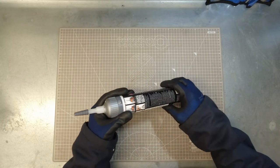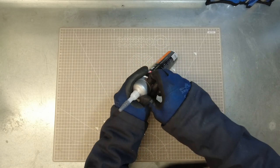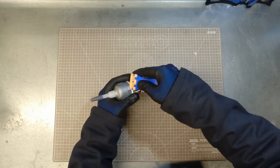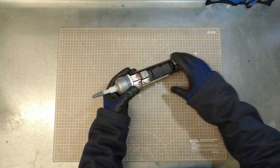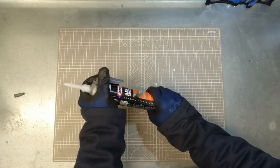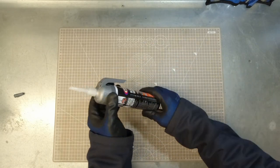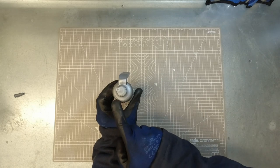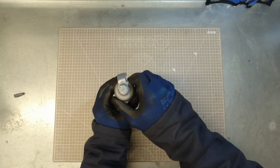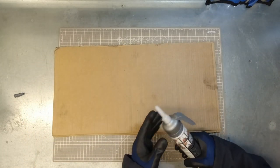So with this, you just pull the little plastic tab here out. I may not be able to do it with my gloves on. Just find the nearest handy thing. So snap that tab off, and then you pull your cap off. And then we're going to turn the top clockwise until we hear a click. And then keep turning, and you'll see that the trigger will pop up like that, and then we can turn the top to set from maximum to minimum, max giving us a thicker bead size and min giving us a thinner bead. This is why I like this stuff.